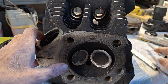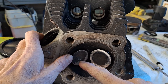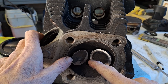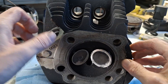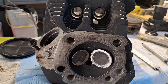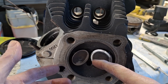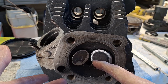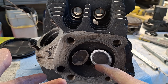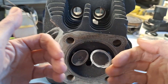What you've got going on here: your exhaust valve is on the closing side and your intake valve is on the opening side, so they're both open slightly at this point. You're looking for at least 80 thousandths between valves — preferably more. With this type of cylinder head and valve configuration, you can only get so much clearance because both valves are opening at the same time.